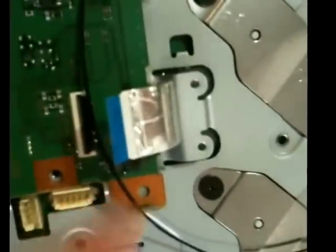And when it's on those little tabs. So then we're going to re-screw all of that back on — there's one screw up here, and then those two there. This slot doesn't ever line up with a screw; another one is going to come down from above in the case when we screw things back on, so you'll never see a screw in that slot there. Let's reconnect this little ribbon here — this just pushes in, slide it in nice and securely, and then flip that tab back down to lock it in place.